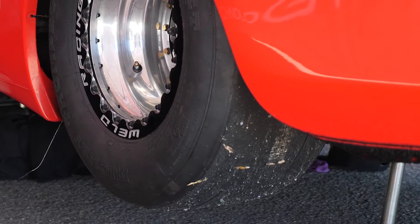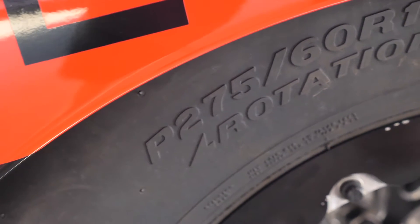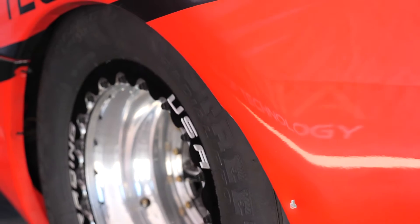You're not actually beating up on the components quite as bad? Yeah, and it's good — it's really opened it up for a lot of people. Just not in the 275 but the smaller tyre classes, the radial things, it's really kicking off. I just want to talk a little bit more about that tyre because the reality is it is actually amazing the amount of traction you can get out of that 275 radial tyre. What sort of ETs are these cars running and what's the best ET you've run in the Supra? Well it's all about the start line — that's the big trick here, controlling the power on the start line. Because once this tyre lets go with traction, that's it, you're finished, the run's over. Our personal best is a 6.79 at 212.